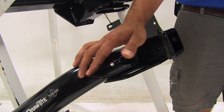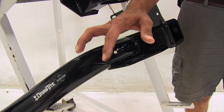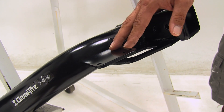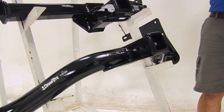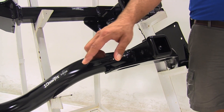Another thing that lends itself to towing with the Draw-Tite hitch is the tab that's been welded on right here. It has three pre-drilled holes that allow you to attach a seven-pole or a four-pole to make the connection to your trailer. One thing to keep in mind though: typically the wiring on the Escape is going to be in the back of the vehicle, so you'll have to bring it down through a grommet to get it attached.